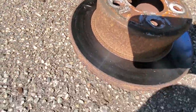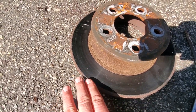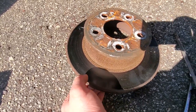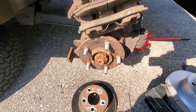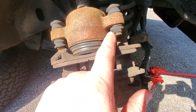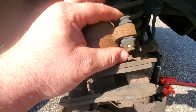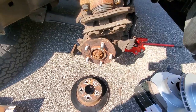All right guys, we got the rotor off and this isn't terrible — it's actually pretty smooth, nice surface, and it's not even that old. There's no real gouge or groove, not like the rear ones — those were awful. You could definitely tell that all the stopping power was coming from the front. The brake pads are fairly new too, so these aren't that bad. I'm going to try to find another boot in my stash to replace that, lube up these pins — it's pretty free. We'll pop in these new pads and this should be good to go.